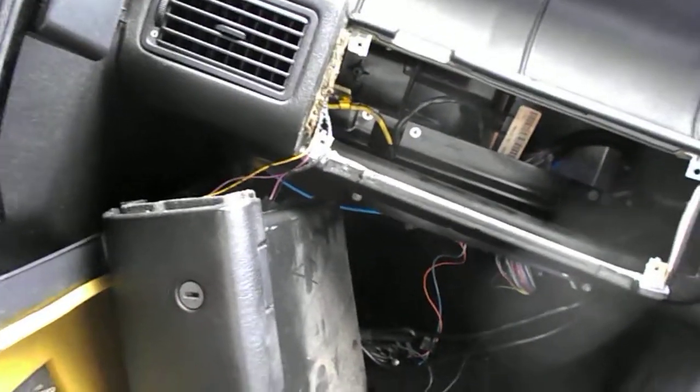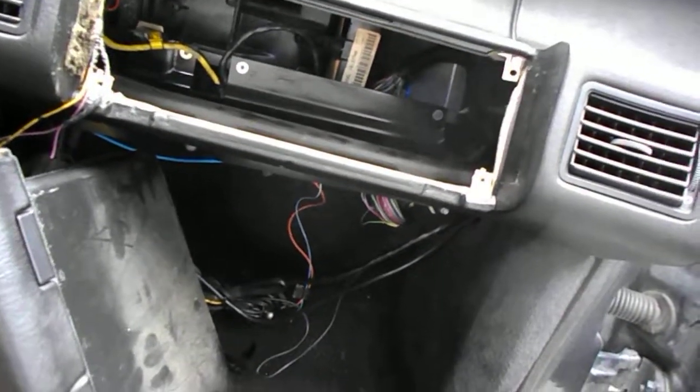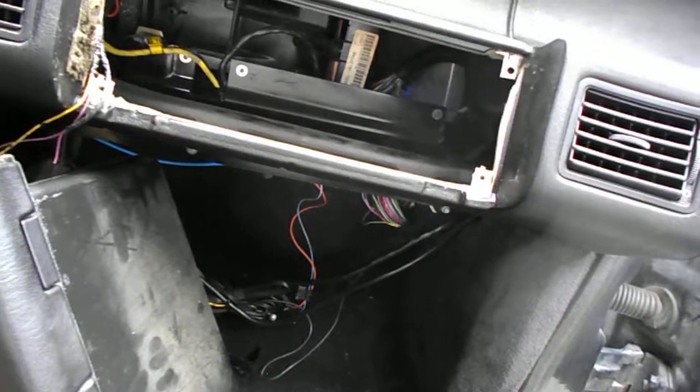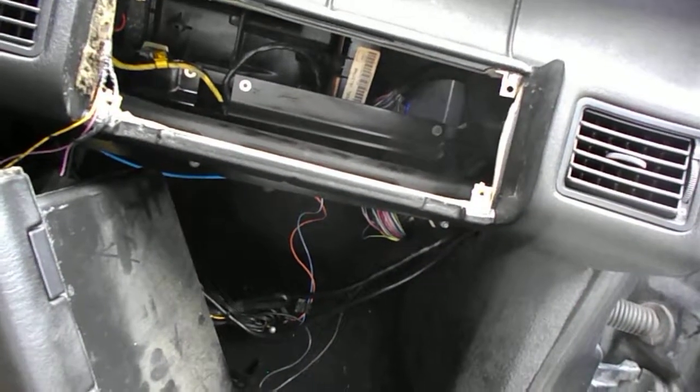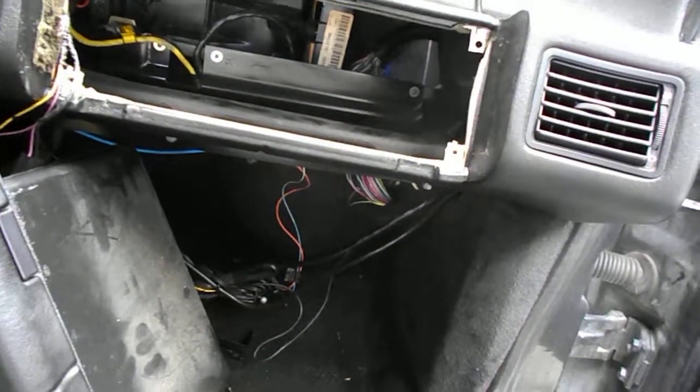When I get the PCM out, I'm gonna start the car, train the camera on the DIC, go into PCM data mode, and scroll until I hit PD 72, which is the turbine speed. It should be a couple hundred RPM below the engine speed, but it's currently reading zero — and that's what set the P0756 code in the computer. What that does is it basically just disables the overdrive at the lower speeds.